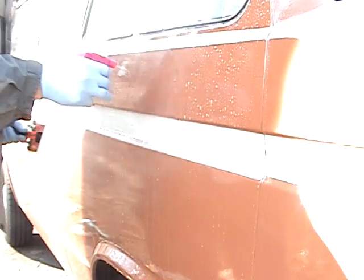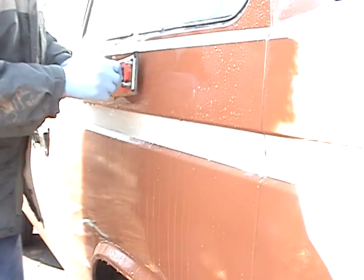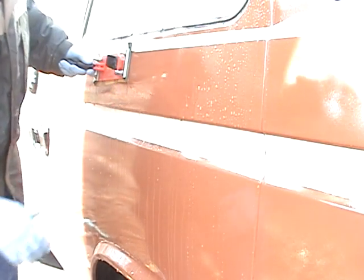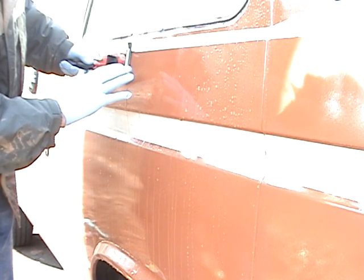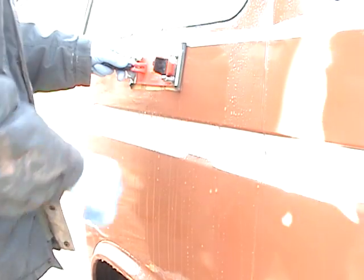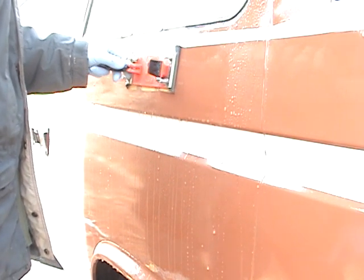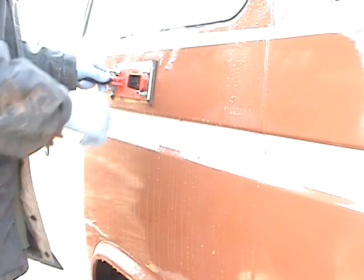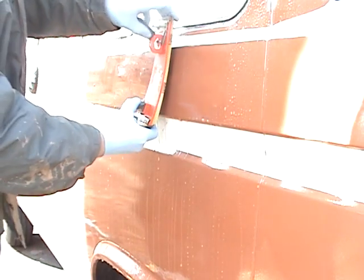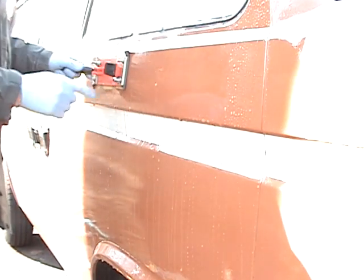I spray down the area I'm going to work on, sand each area, and I can see when I'm sanding it — keeping an eye on it — when I get level with the orange peel it basically becomes all one solid color. I already did the runs with 400-grit; your results may vary, you might be too squeamish to do that. I didn't film myself doing it because it might scare some paint people, but I got the runs out really well. The sags I used the 400 with a block, bending it over the runs, and it came out really well. So I'll go in one direction and do part of the van.